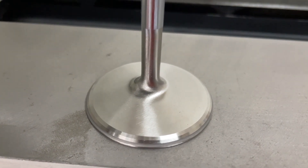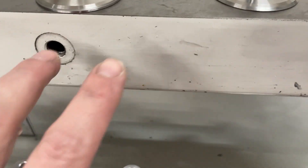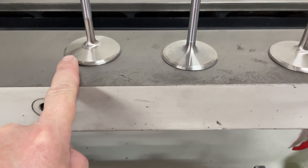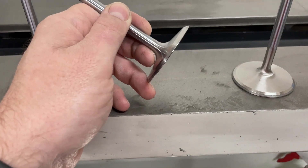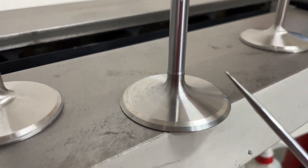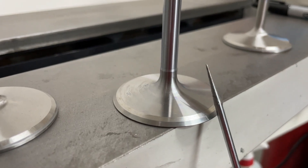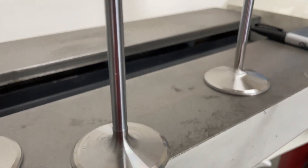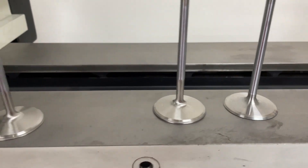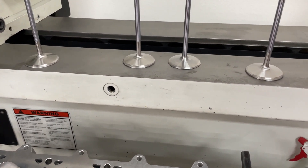I'm going to blend these out, measure the throats, and then flow them. On the 45 it will be flowed with two valves - the one we've been using for all our tests so far, and the Freya. The other ones have to be flowed with the Freya because on a stock valve there wasn't enough margin to put a 50 or 55 degree in. As you go grinding from 45 to 50, it's going to take away the outside edge which is the margin, shrinking the valve down. So 45 flows on both valves, the rest get Freya's. Let me go ahead and blend the seats, measure the throats, and then flow it.